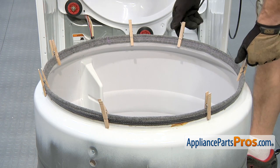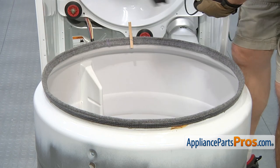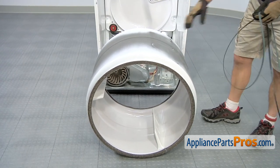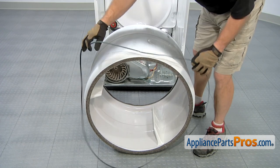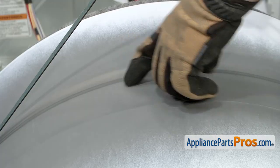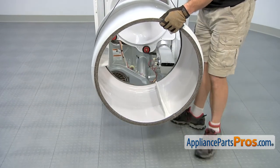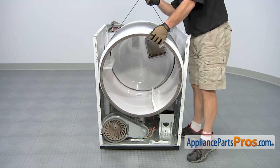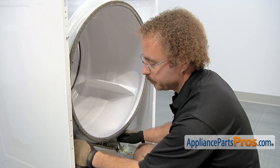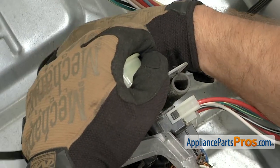Now that you've let the glue dry for about an hour or so, we're going to take all the clothes pins off and flip the drum over. Put the belt back on so we can put it back in the dryer. Once you have the drum up, you can grab the belt from wherever you had it and slip it over. Once you have it lined up where the wear mark is — where the belt is supposed to go — you can lift the drum up and guide it back into the dryer and set the drum on the rollers. Now with the drum back in the dryer, we can reach in and route the belt through the pulleys. We're going to reach in with our left hand and pull the idler pulley over towards the side of the dryer so we can route the belt through the pulleys.